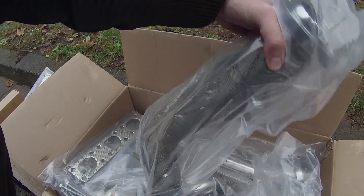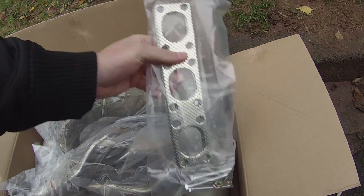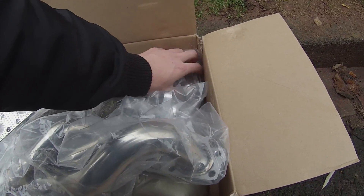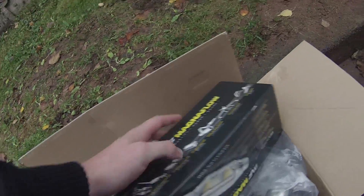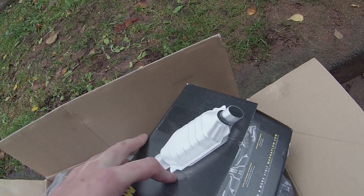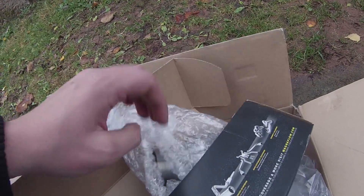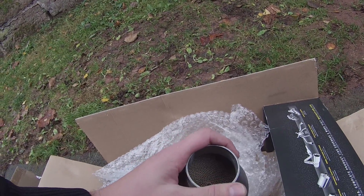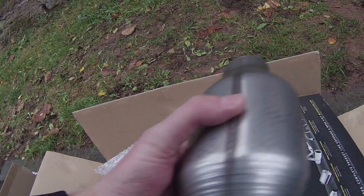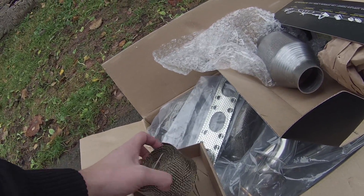One Fächer-Krümmer I've already wrapped with heat protection tape. All mounting hardware is included. And there are two extension pipes that we'll install today. But the whole setup only works if you also use these Cats. Normally you can order the Cats with such parts, but since my exhaust system is dual-flow, I ordered this variant. These are Spoon style with around 52mm diameter — I needed two pieces so they fit side by side. Also included is heat protection tape and cable ties. Let's get started.